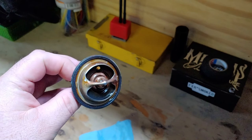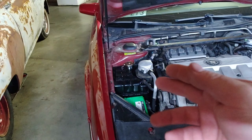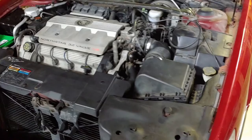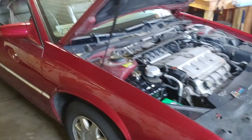I came and looked at this - it's got a little bleed port up top of this little check valve thing on the thermostat, and that's got to be on top. That's the way it bleeds properly. I didn't even look to see if this had it. External canister, pressurized system - obviously it's got that. So I opened it back up to make sure I did it right, and I did. Instinctively I put it in the right spot but I wasn't sure. After all this crap going on, I wanted to make sure. Now that I've confirmed it, it's creeping up on midnight, so I'm done with this thing for today.